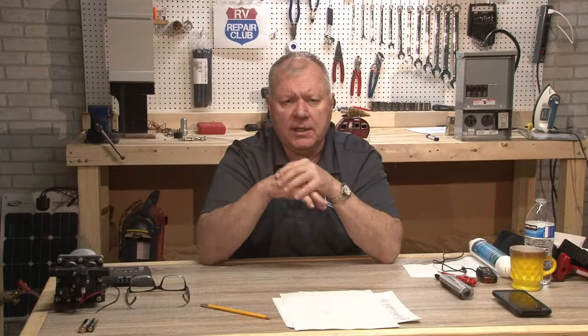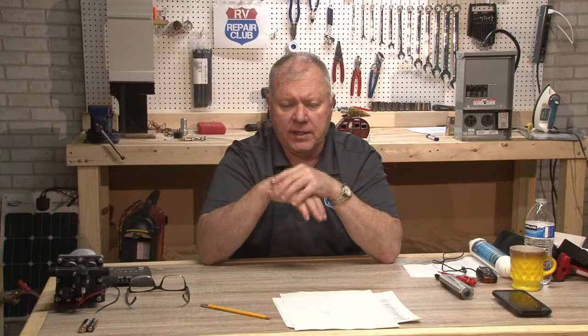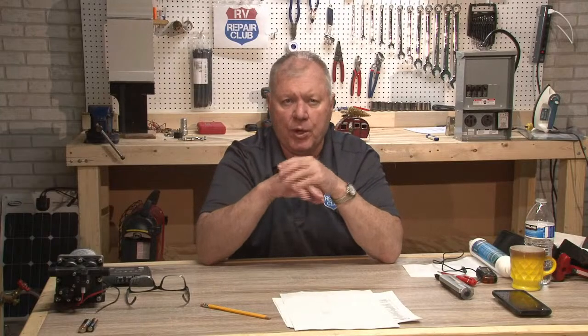I would recommend, in fact, I just had this with a friend of mine that has an RV. He does construction, and so instead of going to a hotel, he bought a travel trailer, and his furnace quit working. And so one of the first things we looked at is he had replaced his battery, but he went down to O'Reilly Auto Parts and put in a cold cranking amp battery. And 6 months later, that thing's no good. So he went down and bought an AGM. He ended up getting a Napa one. And I recommended Trojan, Lifeline.